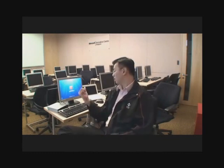The faster choice is to have Windows 7 loaded on a thumb drive. Here I have a 4GB thumb drive, which I'm going to show you in the video next — how to create this drive. All I need to do is plug it into the machine while it's powered off, power on, boot off the drive, and I can have Windows 7 installed as if from a DVD. It takes about 3 minutes to prepare, and installation is a lot faster compared to using the optical drive. Let's see the video and see how it's done.